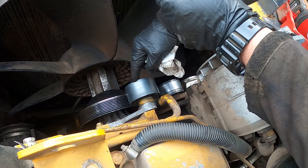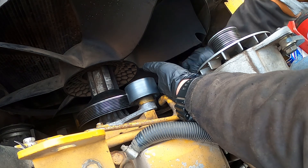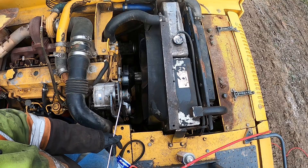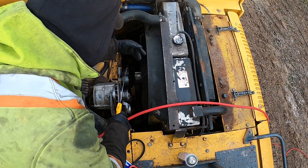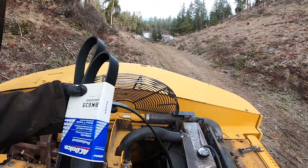Let's do the cleanup. Make sure there's no gunk or any debris on the rollers or pulleys before putting on the new belt. Wipe them out — I'm using brake cleaner — and blow everything off the pulleys. It's a good idea to assemble onto clean parts to make sure it will last.